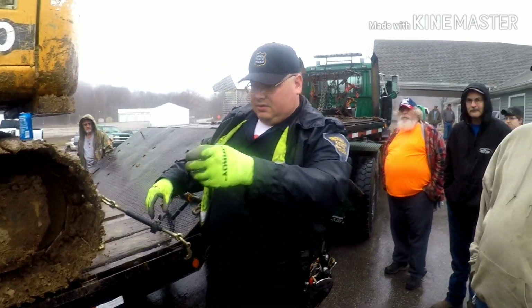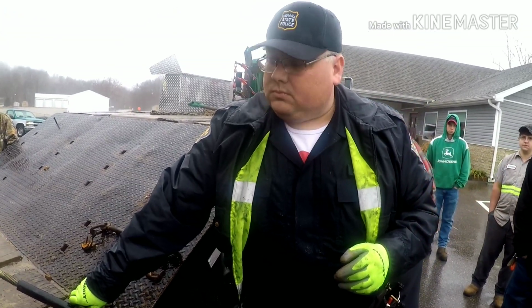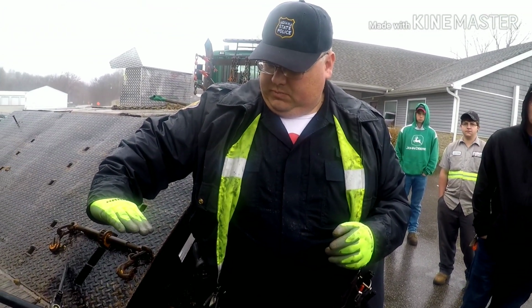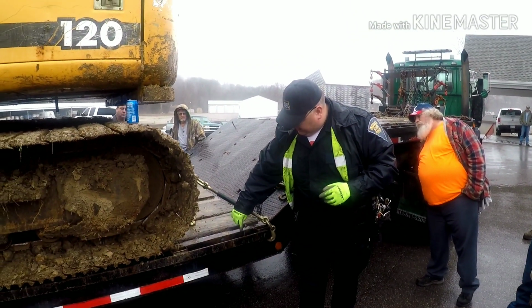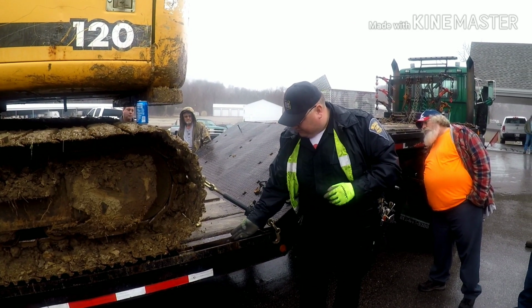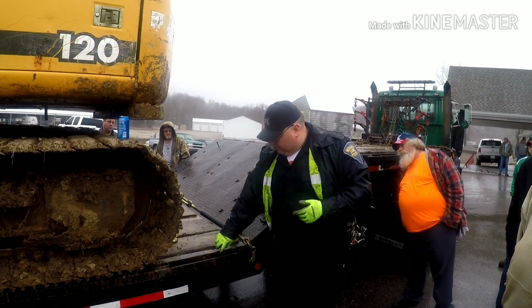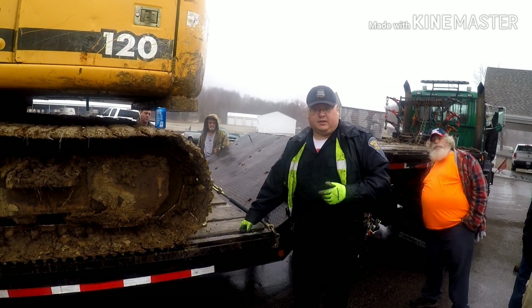Yes, question. Yes, go right ahead. My low boy has the C-frame or the channel stuck out. Is it legal just to hook that binder into the edge of that C-frame? Yes. If the C-frame, we'll just imagine this is a C-frame. If there's basically no room for that hook to slide, if you've got it in a good spot, it's not going to slide and basically make that loose, and the C-frame is not cracked or bent, indicating it's starting to fail.